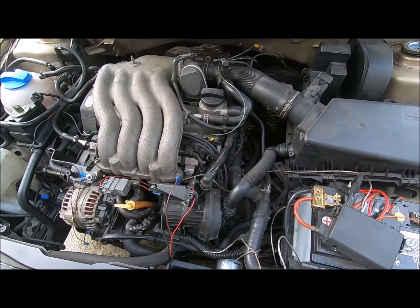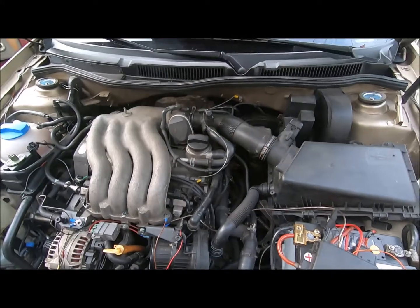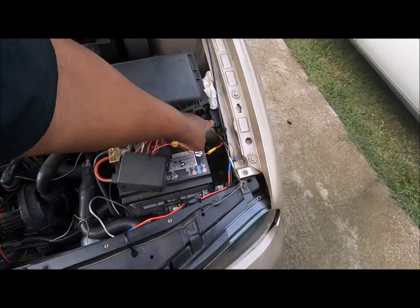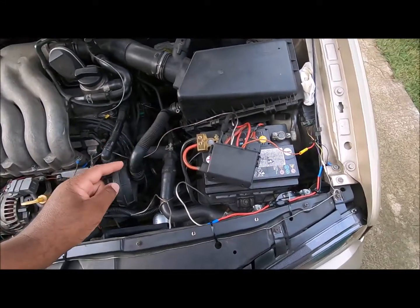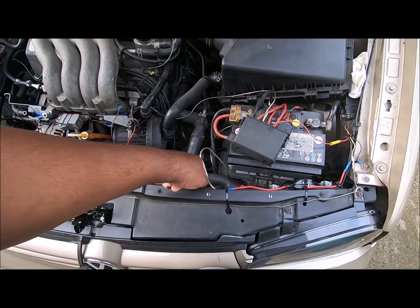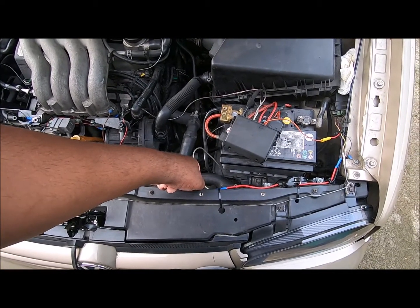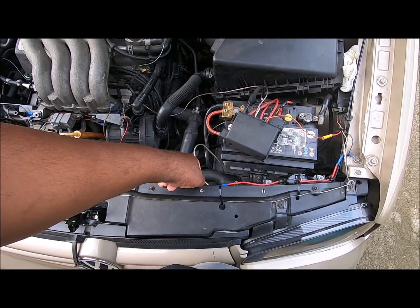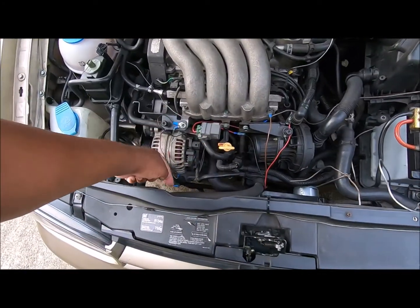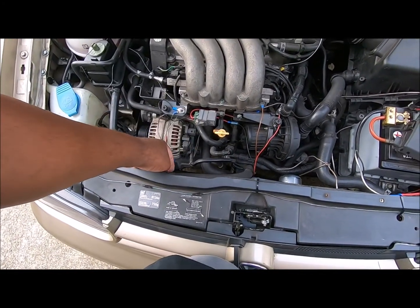But it's not that hot in Georgia and I'm not having any problem with the car running hot. Anyway, I thought I'd make a little video to tell y'all what's going on. This relay here is for the high speed of this fan. The low speed runs through the stock thermal temperature sensor on the bottom of the radiator.